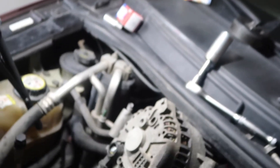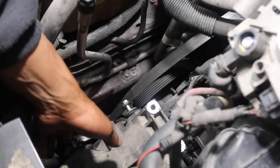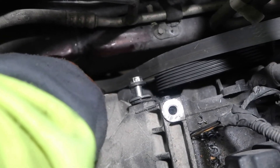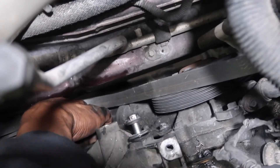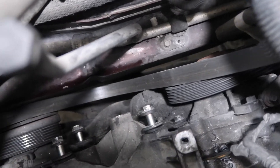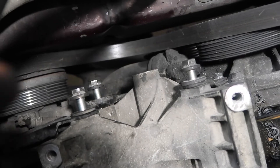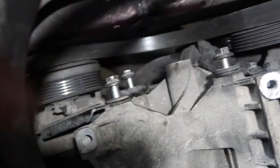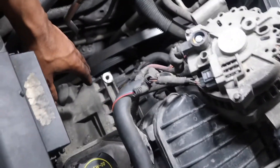I'm going to tighten up the bolts in the top brace right here. Now going with these miniature bolts - they go into the side thing, the little black piece, the part that holds up the alternator. Those screws are gonna be hard for you to see, you're gonna have to be on the side. I'll tighten it by hand as much as I can. These three long bolts go straight through the brace - tighten all three of those and the little ones. That's a wrap for this and all I gotta do is install the alternator.